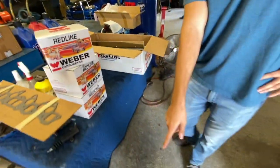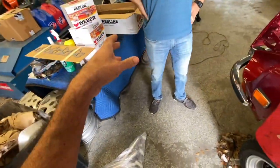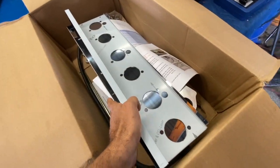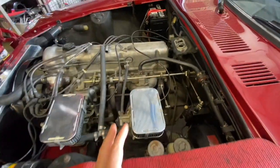Those headers on the floor are the TBC heat-coated ones, which took forever to come in because apparently their heat coating guy went missing — but he's back now, they found him. So we've got the header, the carbs, the manifold, the gasket, and a cool little mount for the carbs. It's going to be quite a job — once you get everything bolted in, that's like 10% of the work. From there you've got to set up the linkage, sync the carburetors, and all that. The linkage is what's really time consuming and becomes the bulk of the work.